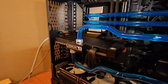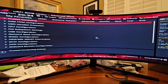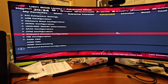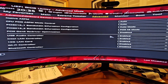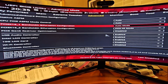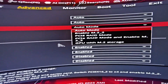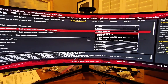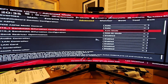We're going to power it on, go into the BIOS, and do some configuration. In the advanced menu, go to onboard device configuration. You've got your PCI Express 16-lane slot 1 and slot 2. For slot 1, put it in auto mode. For slot 2, put it into by-8 mode. If you go to slot 1 and enable M.2 or any option other than auto, slot 1 will only run on 8 lanes of PCI Express — so your video card, which is probably a 16-lane card, would be running at half bandwidth capacity. Definitely don't want to do that.